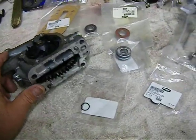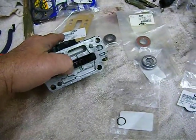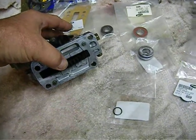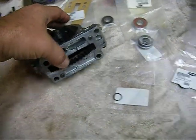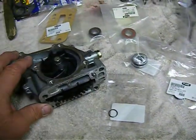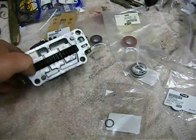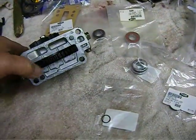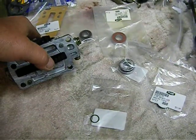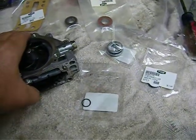The reason why I'm rebuilding this is because this particular pump runs off the engine crankshaft and it's bolted to the crankshaft. It's designed in such a way that when this seal fails you end up flooding your engine with coolant and you throw a rod or hydraulic your engine or bend a rod or break things — it's a huge catastrophe inside.